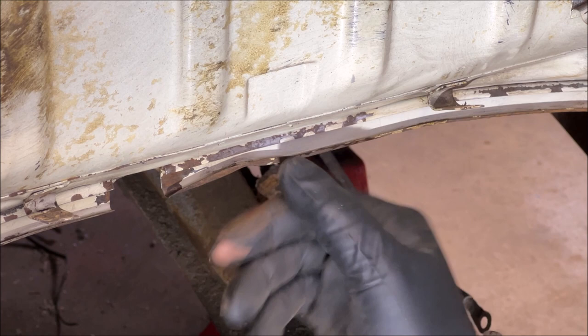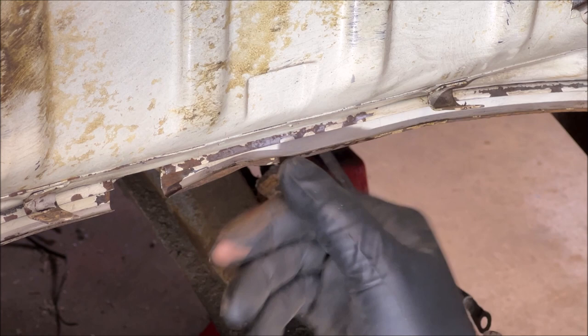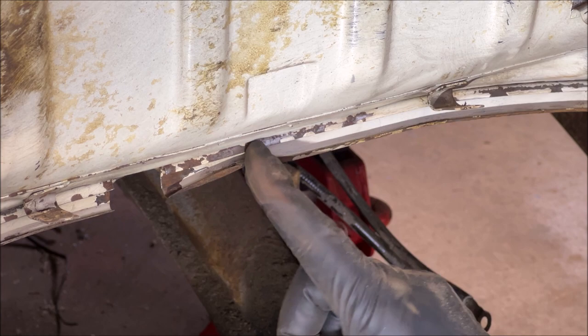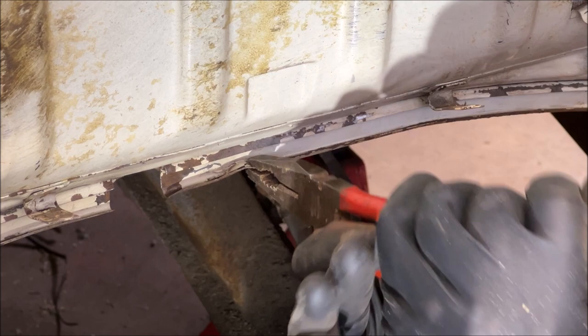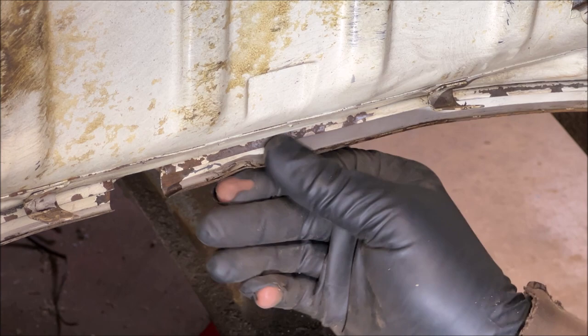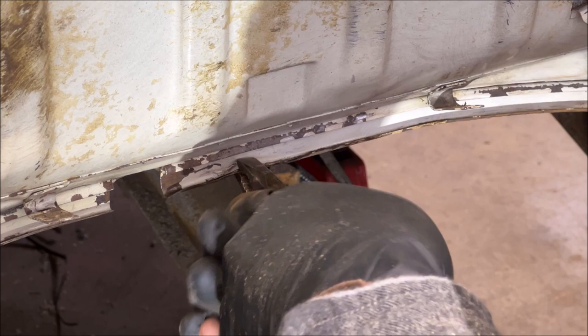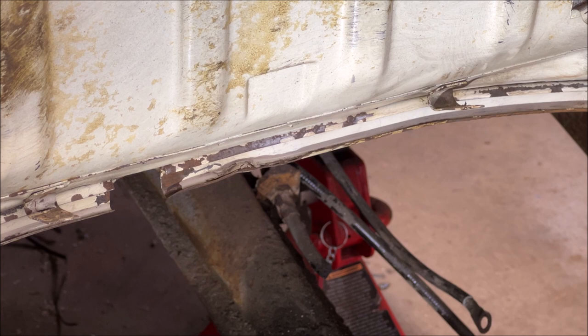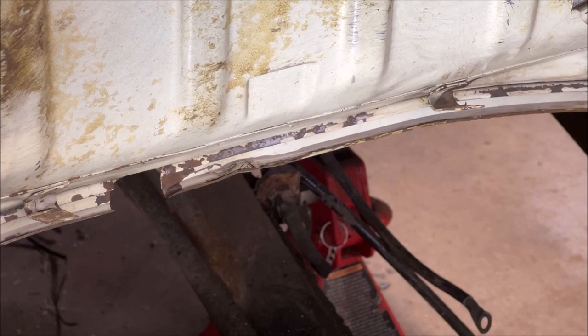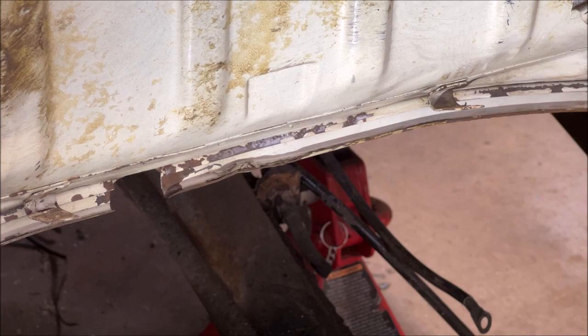I'll get up there where your seal goes in — the molding. Sometimes people will tap it a little to pinch the seal so it doesn't move. Go around and straighten that out. I bend it out like that so I can slide the seal through, and then I go through and just tap the trim back up to hold it tight — because if not, you're going to be fighting with it. So we're going to wipe this down and get ready to put the rust bullet on. Just trying to show you everything I'm doing along the way.